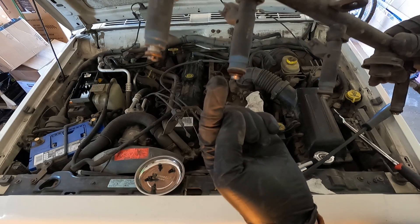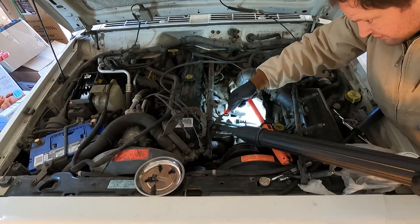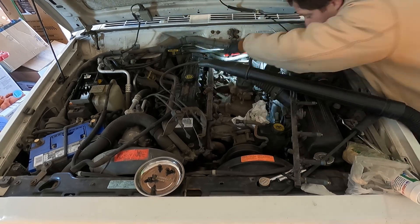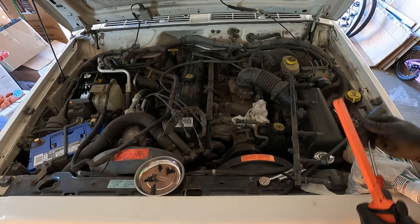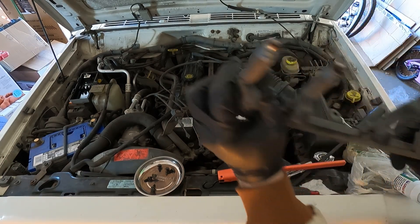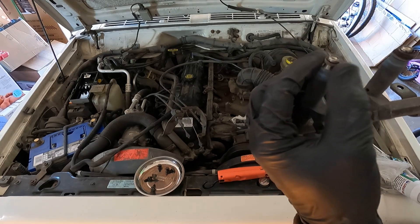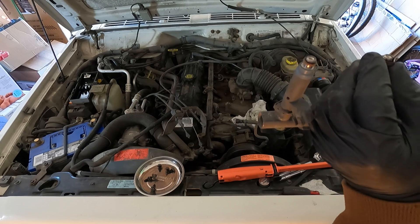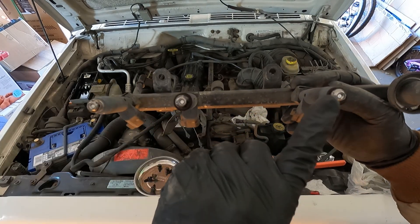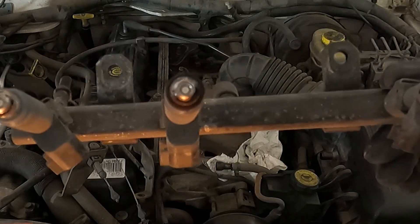You can see here there's a difference between these two, and the o-ring came off of that one. I just cleaned out all the injector holes. On number one, this o-ring had completely rotted away and was just sitting there on top of the manifold in crumbles. That's why I started vacuuming it. It turns out it was a good idea because there's a lot of junk in all of them. There's only one hole in this injector, so we'll go ahead and switch it out.